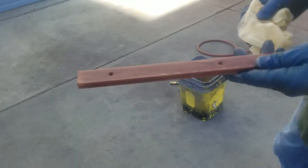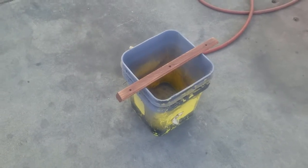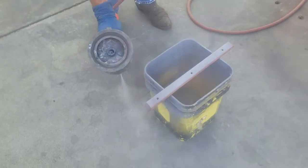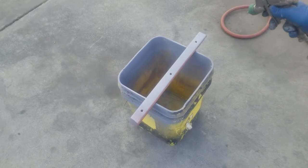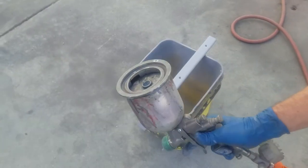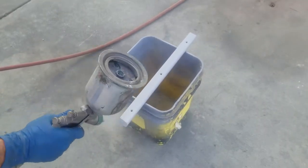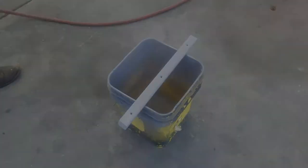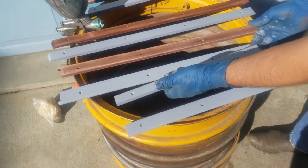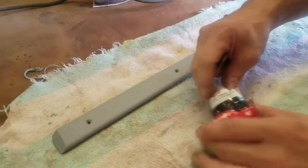The way I normally spray is running 60 pound line pressure, three to four actual pressure coming out of the gun. I'm going to wipe everything down with a tack rag, set everything up on my bucket, and spray back and forth — about four sprays per direction. I'm putting it on fairly heavy because I'm going to sand some of this off. This is about getting a thick spread so I have something to sand off and take out imperfections, which is exactly what primer surfacer is for. Here it is drying — at 84 degrees it dries pretty fast, under 10 minutes and it's ready to sand.